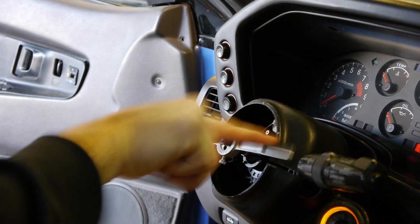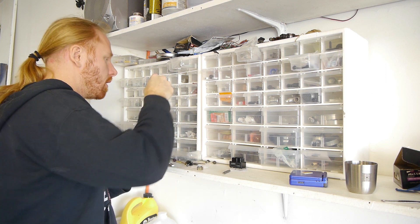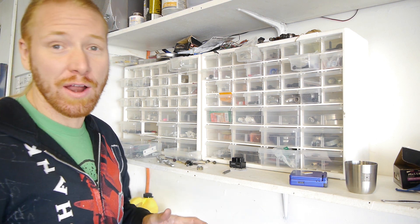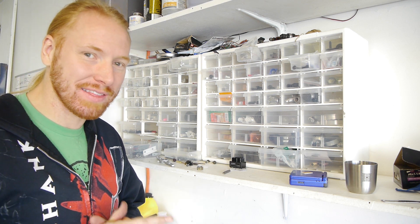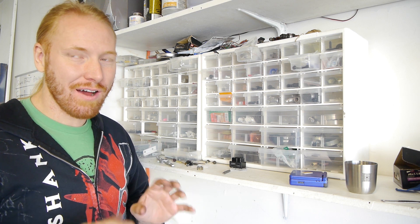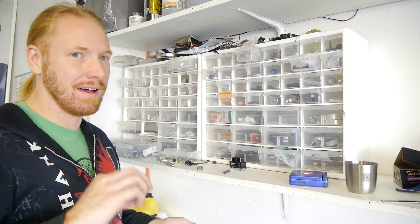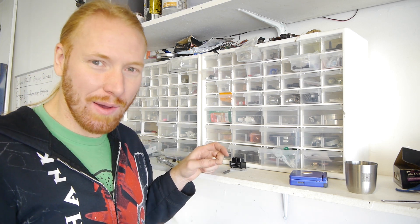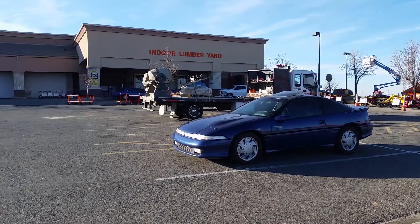The tap likes it. Let's try a nut. It doesn't look like I have an M12 by 1.5, so I'm going to run into Home Depot and get one. I'm also going to get an M10 by 1.5, just in case I want to cut those threads a little deeper. The M12 threads are there but I don't think they're quite as deep as they should be. I think it'd be better to have more secure threads on a smaller bolt size, but I'm not sure. So I'm going to get the M12 bolt, see how I like that, and if not, we'll cut them down to M10. And yes, I am driving around without a nut holding the steering wheel on — I don't recommend it.